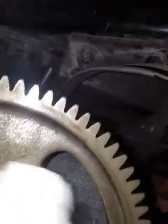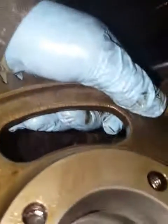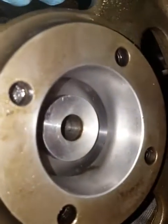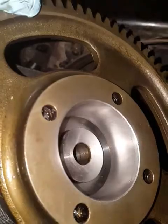Let's get a rag and wipe it. I don't know if this video is going to show it very well — let's mark it down in evidence. You can see the metal sticking out on the gear; it's supposed to be smooth in there. There's a big metal chunk right there — that's definitely metal. No evidence of retaining compound whatsoever. I don't know if you can see that, but that's metal.